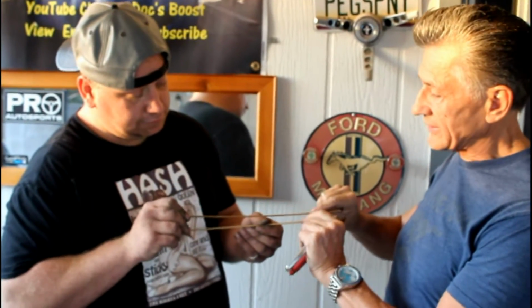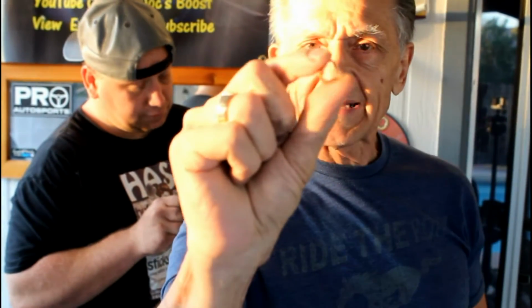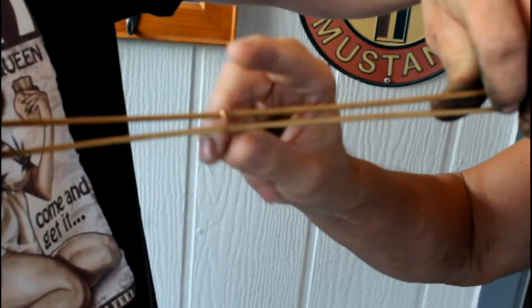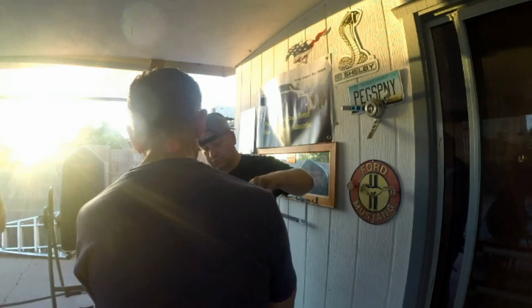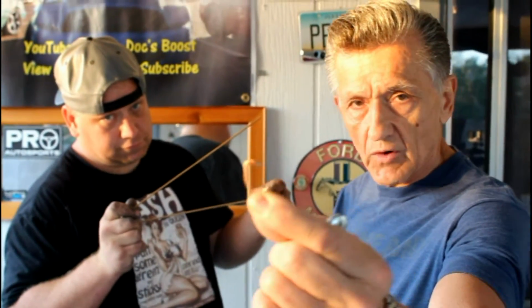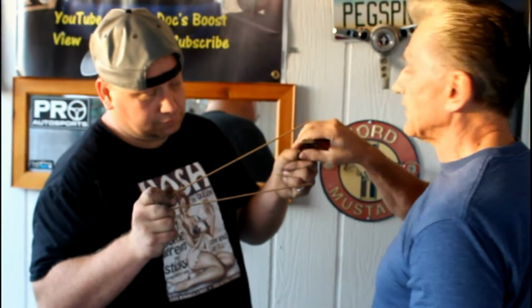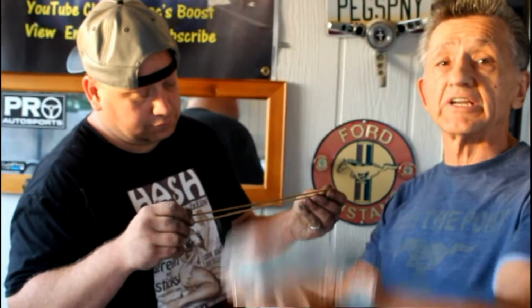So on the inside there, when I pulled the seat cover up to that point, what I find is a ring like this, a hog ring, that's connected like this. That's the hog ring, and that's what it's going to look like. I said, two here, and two here. And what you see me doing in there is just taking a pair of side cutters, grabbing it, giving it a twist so it separates, because a hog ring actually looks like that. So I need to twist it so it opens up again so it can come off of there. Separate that. Do that 6 times to separate the seat cover from the seat back, and then continue on.